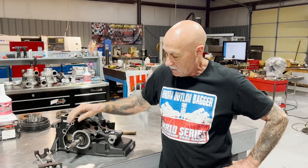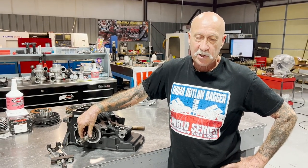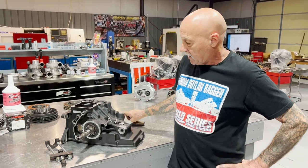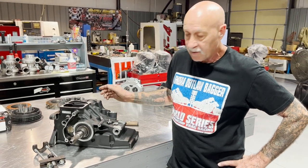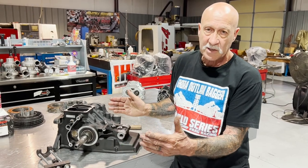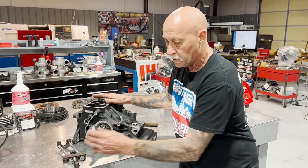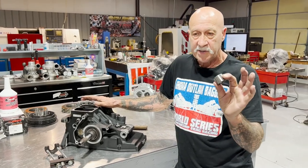That's a little tech tip on the Harley 6-speed and 5-speed. So when your inner race is jammed up against high gear, you loosen the nut on the opposite side from the main shaft, tap it with a little hammer lightly, the main shaft comes over approximately 60 to 80 thousandths. You put your tool in there, pull it off, and you can reuse it.